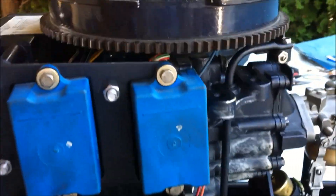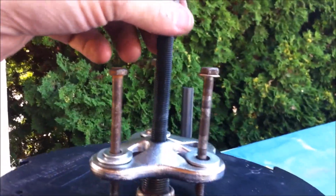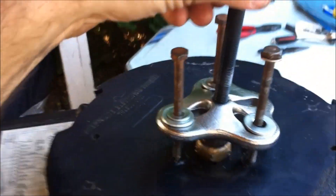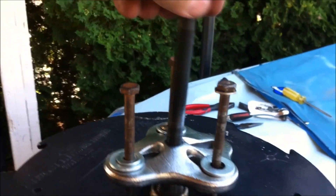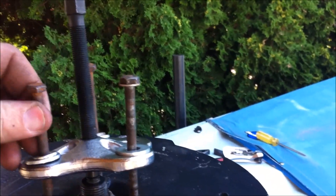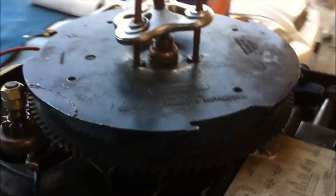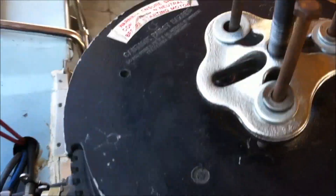I want to make a note here — I put the flywheel on, but taking it off at the beginning was a pain. We happened to have a garage sale that day and I got this puller unit. You basically tighten these bolts down and then tighten this on. But even as I tightened it, it was pretty amazing trying to get that flywheel off, because it's been there since the motor was made in 1989 — torqued on, stuck, and even rusted down a little.